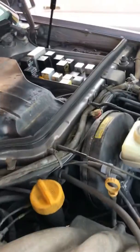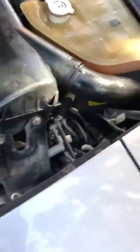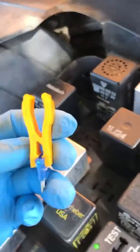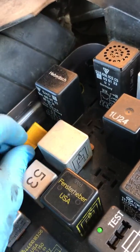Who knows how safe that is. Over on the fuse panel, number 34 is the magic number — that's the fuel pump. You don't want fuel running through your lines. So if you still have this little puller, pull it out. You could use a needle nose, whatever, get it out. Pop it out.